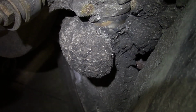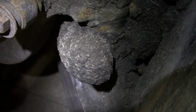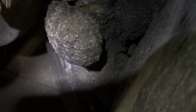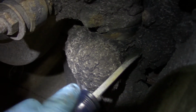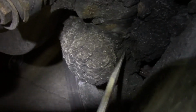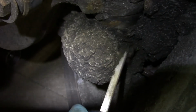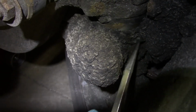So I'm on to the other side of the truck, and this top grease fitting took grease no problem. You might be saying, if you're looking at your truck and no one's ever installed caps on your Zerks, where is the grease fitting? So just take a screwdriver, start digging around, and most likely it's just buried under gobs of grease. So I kind of know where it is because I already was just staring at it on the other side of the truck.